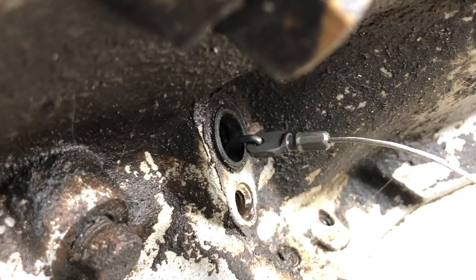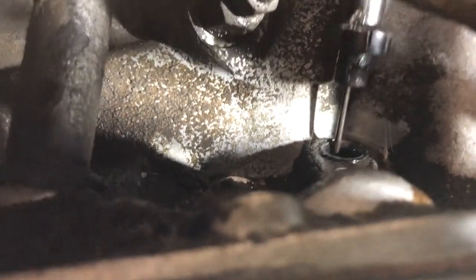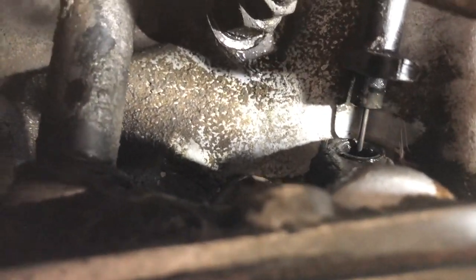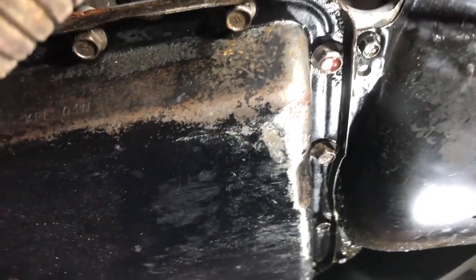Let's take a look inside the one in the truck. That cable is coming from under the hood right here and goes down into our transmission. There's a little 10mm bolt that I've already taken out, and we're going to pull this cable out — we should see that S-hook. We've got that thing out now, but when I pull it, as you can see, it's all cable and no S-hook, no plunger, nothing. So that's pretty much telling us there is a problem inside. We're going to go ahead and pull this pan off and see if we can see it without taking much else apart.